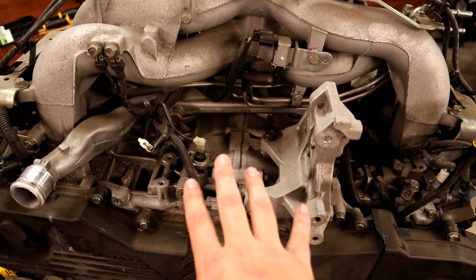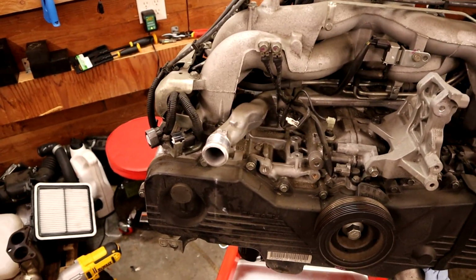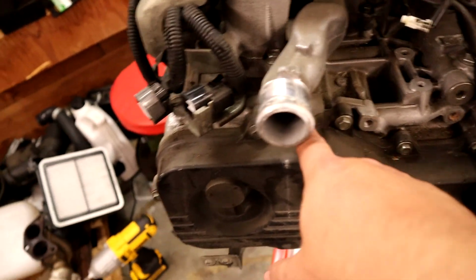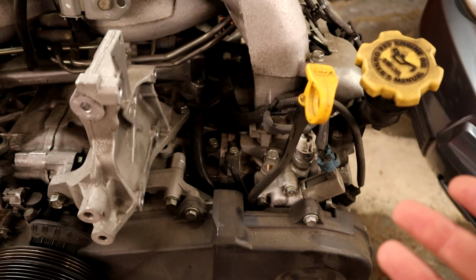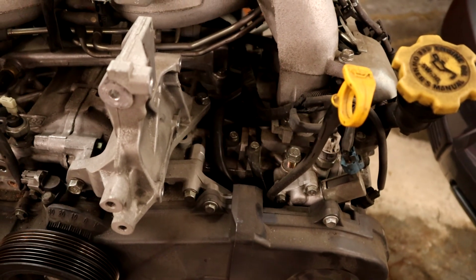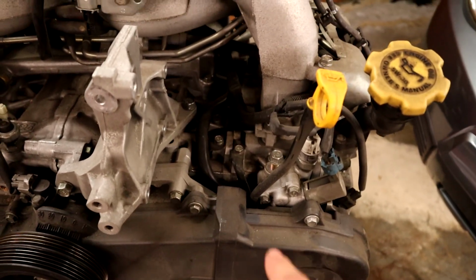So you have your main engine block here, and then here and here, these metal parts are the cylinder heads, and that's where the head gasket leaks. So the head gasket will leak on these things, kind of in this. Where is that joint? It's easier to see on this side. So this sort of separation joint right here, you can see that head gasket will leak, and that's kind of a design flaw on Subaru's part on the gasket material. And the gasket design, it's a single layer steel gasket with some other gasket material on there, where most successful gaskets on an open deck design like this are multi-layer steel.